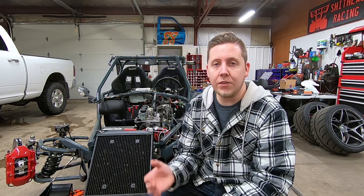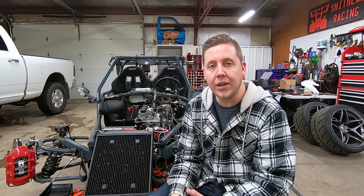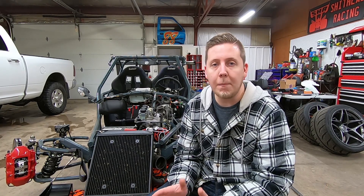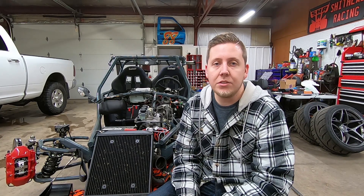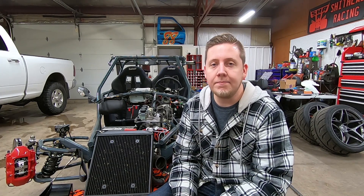How long you want to wait to find parts is up to you too. The manual brake conversion is about $350 — roughly $300 for the master cylinder plus the extra stuff you need. It's not a difficult swap, but you do have to bend some brake lines and modify some things, so that's probably the most difficult part of the whole swap. So is it worth it? That's up to you. Give it a shot, see how you like it. I really like it and I'd recommend it, but you're going to have to decide if it suits your build or not. We'll see you soon.